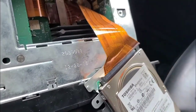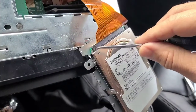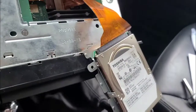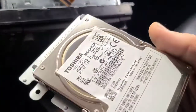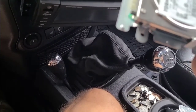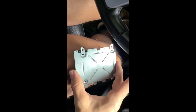I'm going to carefully use a little pick and separate the ribbon cable — just by putting a little bit of pressure in the corner and working your way out. Then I'll take this old hard drive out. Basically start at one end and work it like that. So that's the old one. We'll take the old one out and put the new one on this plate, then put the ribbon cable back on.